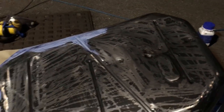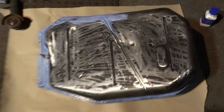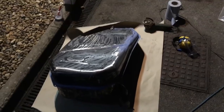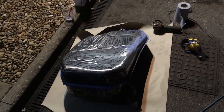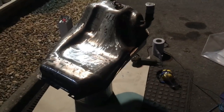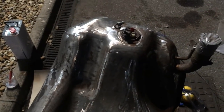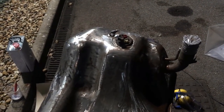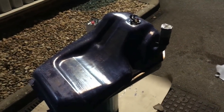I've done the flanges and the return. The whole of the underside is rust free - I think it's just years of having engine oil and grease dripped all over it, but that's good. I'm gonna get some axle stands or a box, flip it upside down and do the top side. Found a pin to put it on so I've got a nice working height. Under what looked like surface rust it's really good metal, so I'm chuffed - especially the filler neck because that's always a weak point.